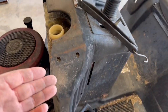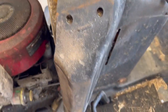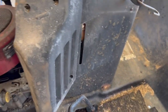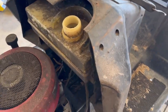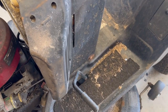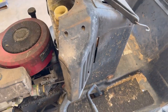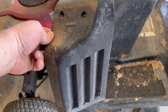This is the Murray wide body and it's got these extended wings with a couple of screws on each side that we'll have to remove to be able to get to the screws. In the past, with customers' permission, I've drilled a hole right in the side to gain access to those screws, but I think we'll be all right. We'll just go ahead and remove these four Phillips screws. Once you get them loose, this side panel will just come right off.